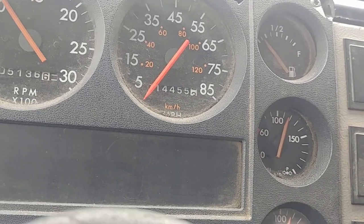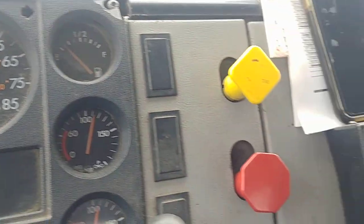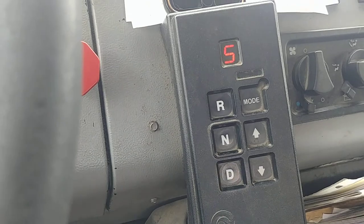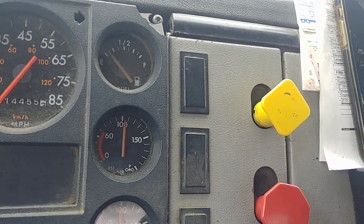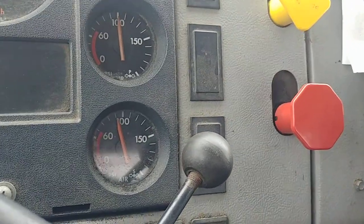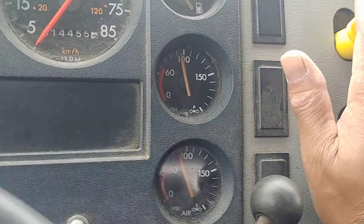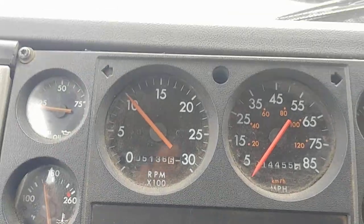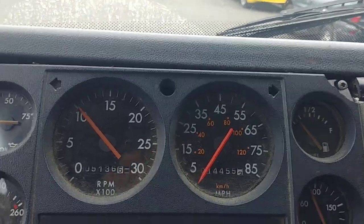I'm going to check the parking brake. The parking brake is on, the trailer brake is off — now shift to drive. See if the parking brake holds the truck. It holds the truck. Now do the trailer brake — trailer brake is on, it also holds the truck. Now the service brake — see if the service brake stops the truck. It stops the truck, not pulling to the left, not pulling to the right, which means it works. It's done.